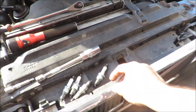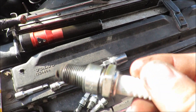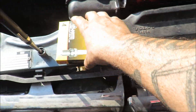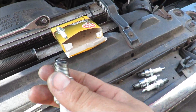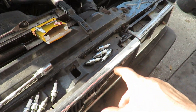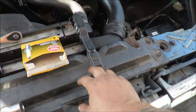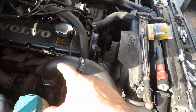These were the plugs that were in it after we did the head gasket, and I kept messing with them. I went and got a different set of plugs, had those in the car for a bit, and I just pulled them out — they're loading up as well. So I went ahead and ordered some BPR7ES plugs — I believe that's what they're called — and I'm gonna throw those in.